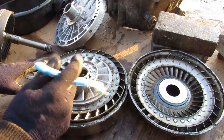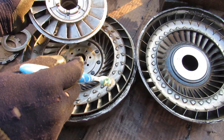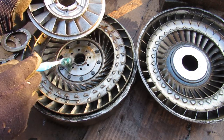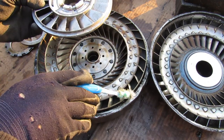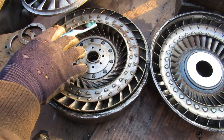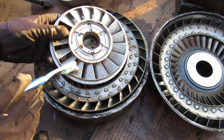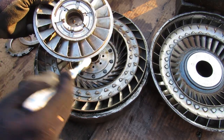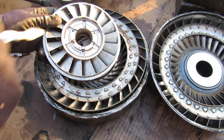That rotation is what allows the turbine, and thus the transmission and wheels, to turn with the engine speed. Fluid then makes its way through the turbine and back down into the center to be recirculated into the pump again. However, the fluid has now changed direction — the fins are now pointing clockwise — and that's why we have the stator, to change that direction with its fins in the opposite direction of the turbine and send it back out to the transmission pump for better efficiency.